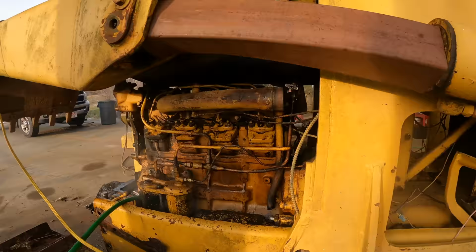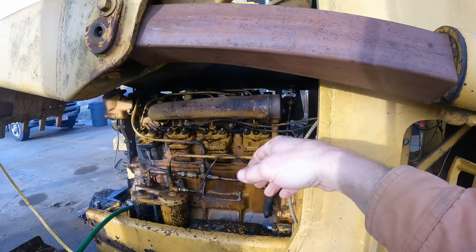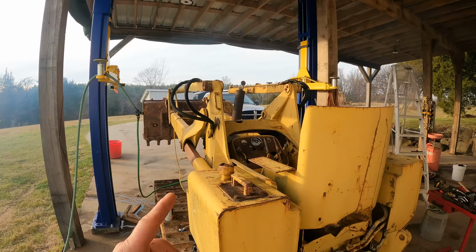I gotta hit the off switch, which is covering the intake. All right, so we heat cycled her again. So just there when starting it, I totally forgot about the glow plugs. And next time I do that, I'll give that a try. I bet you that would have done it. You know, this is a pre-combustion old diesel. It's gonna need glow plugs to start. I didn't have to do a whole lot to get it going. So I'm impressed.